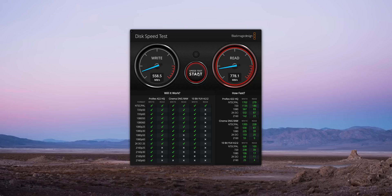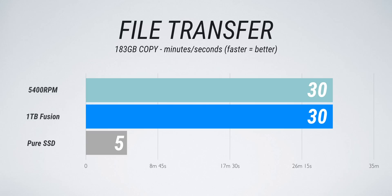Performance on that fusion drive initially is kind of amazing — you run that test and you think it's crazy fast. But once you give it a little time and it runs its course, you'll see the advantage is in that initial burst, because after it levels out it's about 100 megabytes per second, both read and write. So there is an advantage jumping from that 5,400 RPM hard drive up to the fusion drive. But if you're curious what advantages an SSD would get you, I took about 183 gigabytes of footage and transferred that from our Jellyfish server down to a 27-inch iMac with a pure SSD — that took about five minutes, which is really fast. For comparison, on the 5,400 RPM iMac and the fusion-equipped iMac, that same task took about 30 minutes, which is a huge difference.